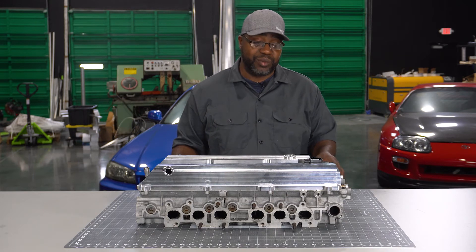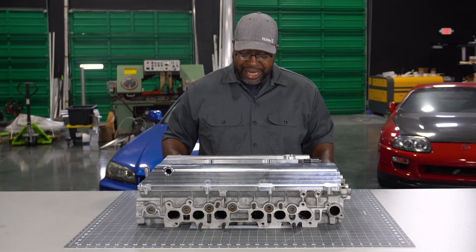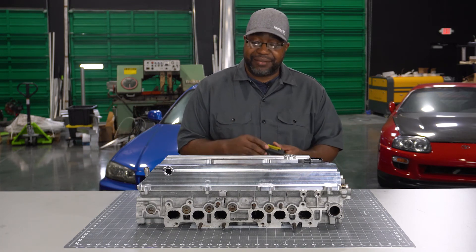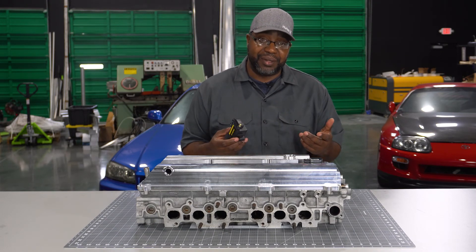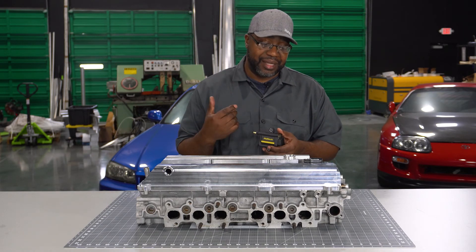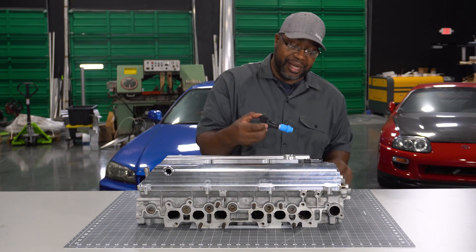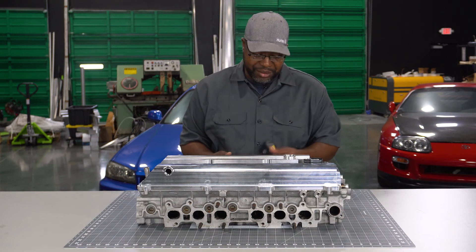This video isn't going to have any details as far as which one really makes the most power — we already know what you're going to get. With the IGNs it's by far the highest ignition output, but obviously you give up the ability to tuck your covers. If you want max power, IGNs let you run a larger gap on the plugs and actually have a much more powerful discharge on your spark energy per cycle. Beyond that, your next best option are going to be the R35s, which will tuck under the cover.